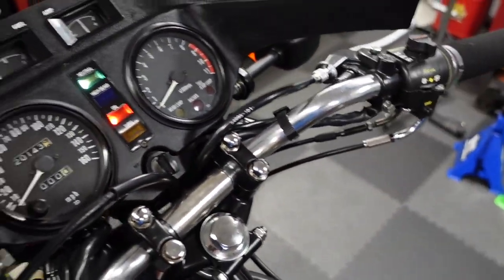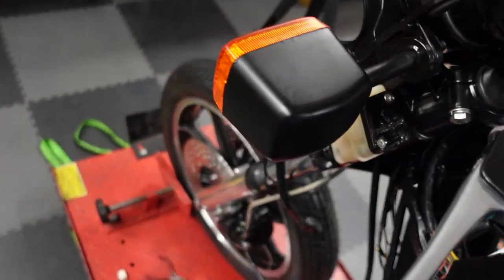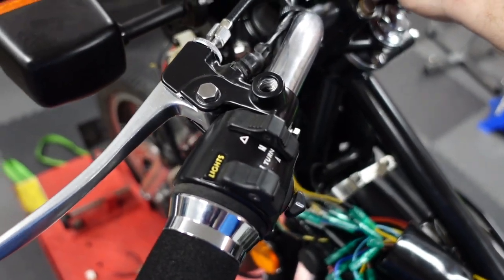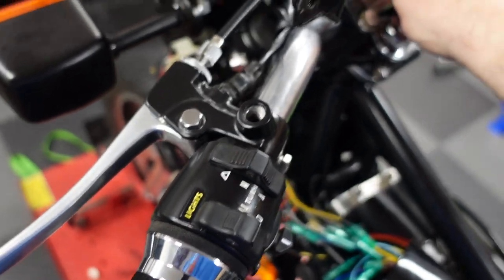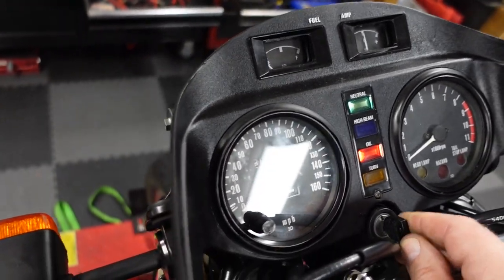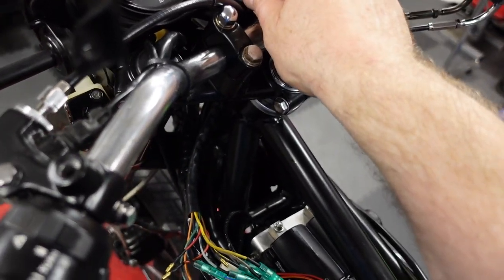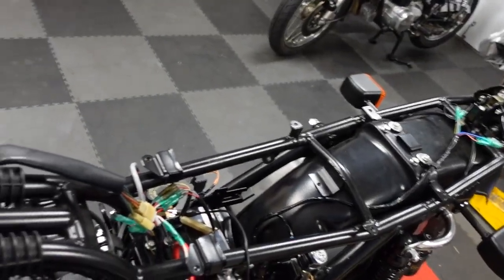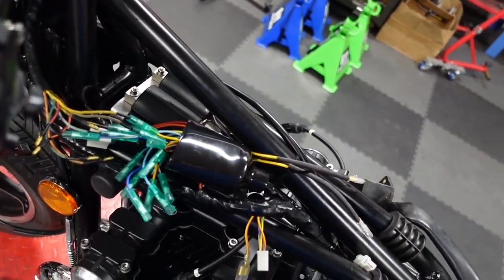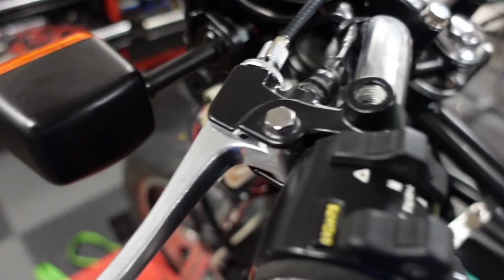It's been about 4 hours. It took probably 45 minutes to change those 2 9-pin connectors. Some of the little prongs didn't want to go back in. It was a real pain in the neck. Anyway, when you turn it on, it is supposed to have the oil and the neutral switch on. Haven't got tail light yet. Haven't got any signals or anything. So I'll keep plugging away.